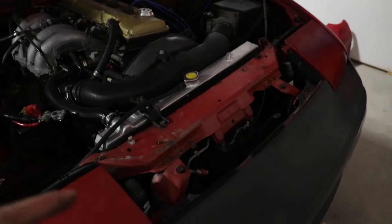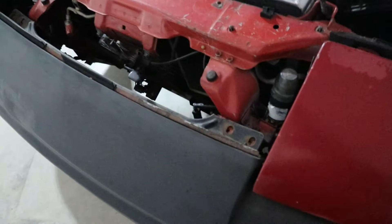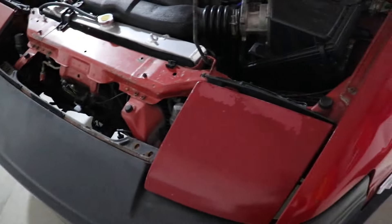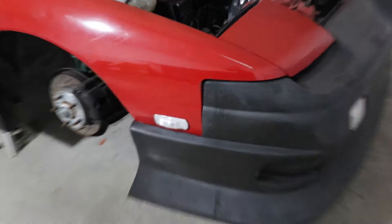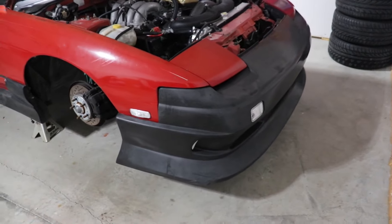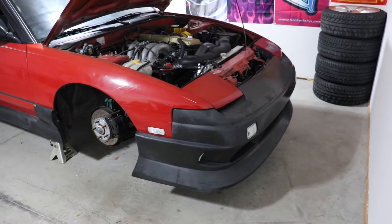The factory bumper has a metal bracket on top, and you can connect that metal bracket straight to the KVD bumper so you don't get any sag up top — the hood stays flush. There's a bolt where the factory bumper mounts and two bolts down below. I've taken it on the highway multiple times and never had any problems with sag or folding. Pretty easy overall.